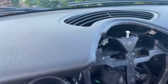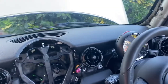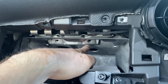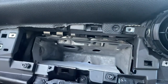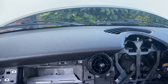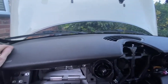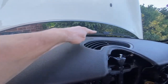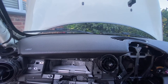Even after all of that I still couldn't quite understand how to get it off. When you've undone those, there are two Torx T30 screws which hold the airbag — the airbag is under here — so you need to undo and take those two big Torx screws out. After that it's ready to come out: grip both sides, pull it towards you and wrench it. It unclips from some clips near the windscreen that are retaining it.